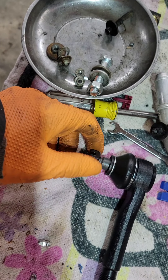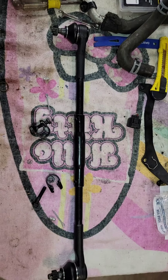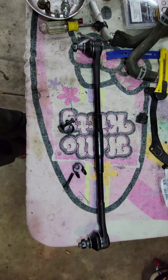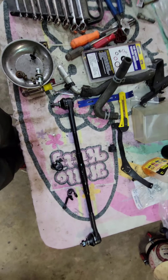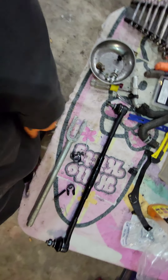Make sure you put your zerks in on the back sides of these — you're gonna want to grease them. We got fresh cotter pins and fresh nuts, everything is all brand new. We are going to use a pickle fork, which is actually one of these, to pop out those ball joints, tie rod ends, and everything. Big hammer, pickle fork — there you go.